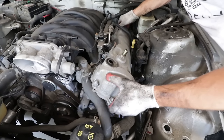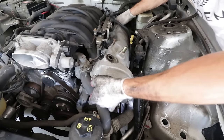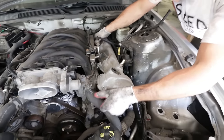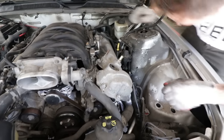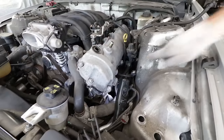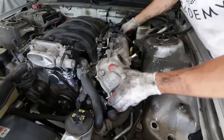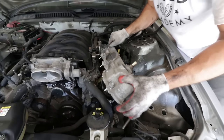The cover is tight and close but it's not coming off freely — the dipstick is really in the way. There's a small eight-millimeter bolt that holds the dipstick, so we loosened that, which gave just enough room. With the dipstick loose, the valve cover slid right out — made all the difference.